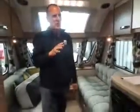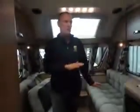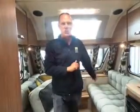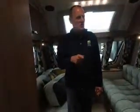To heat this whole van and 10 litres of water, 2 kilowatt may not be efficient enough, so you might want to dual fuel it. In the summer, 2 kilowatt is probably efficient enough because all you're going to do is heat your water. So hopefully it's warm enough you don't need to heat your room. Apart from say in the evening, you may just need a bit of heat, but it should still be efficient enough to do that.